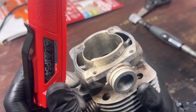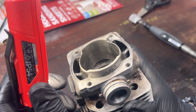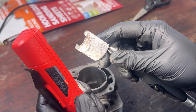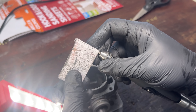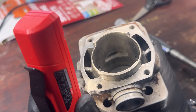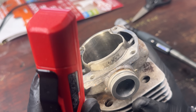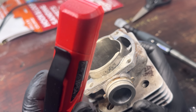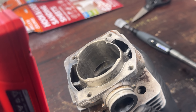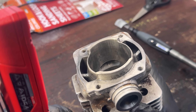Then you can wrap a length of abrasive around the mandrel and use that to remove the transfer. As you can see, it saves a lot of elbow grease and does a great job. All you have to do every so often is tear away about an inch of the paper so you've got fresh abrasive. Be really careful around the ports because the aluminium is soft and can be damaged, but it does a great job and is very quick.